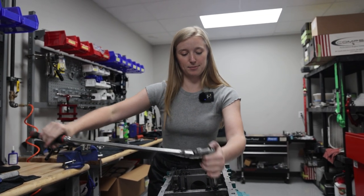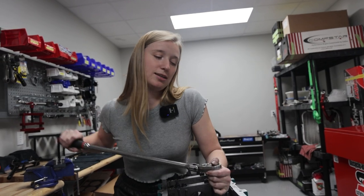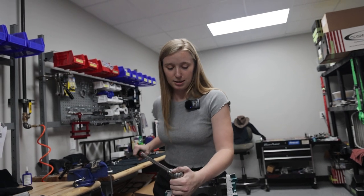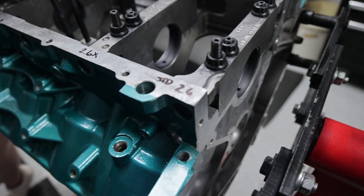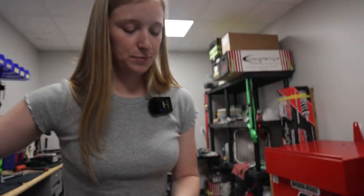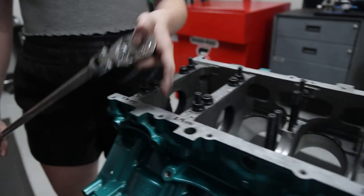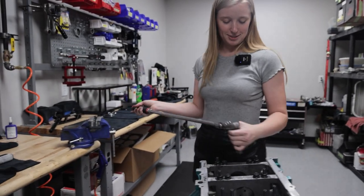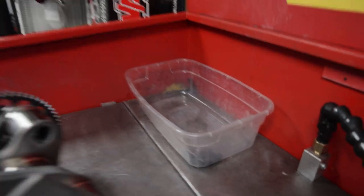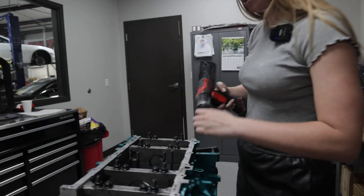These gaskets that we measured multiple times — we're going to clean everything and clean the block so that when we put it all together it'll all be correctly measured and everything will be sterile and clean for when the crankshaft gets put in. You've got to be at LS Fest soon. You've got all the different bearings — four that are standard top and bottom, one top and bottom that are X. So we put the X bearings there and the standard ones. We marked it on the block so we know what we're doing and you can easily erase that with some brake cleaner. 2.4 to 2.6 is pretty good, everything's within the threshold, and it's good to go.